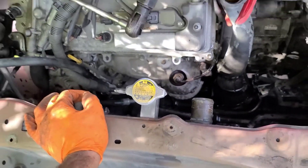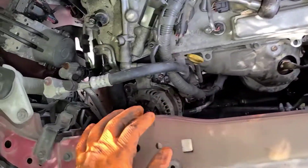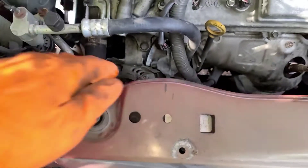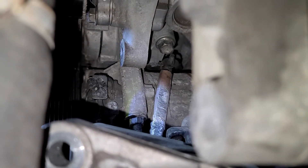You've got to play a little bit with this hose here so the fan will come out. Other than that, you've got your alternator. Your alternator is going to have three bolts — one here, a 14mm, and on the bottom another one.